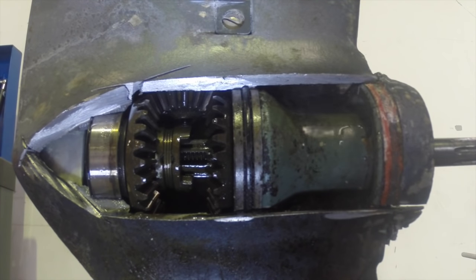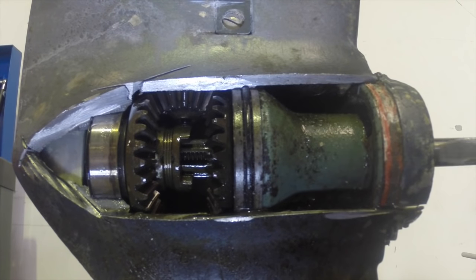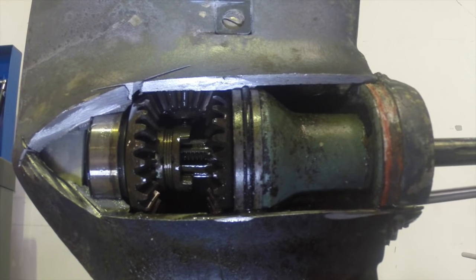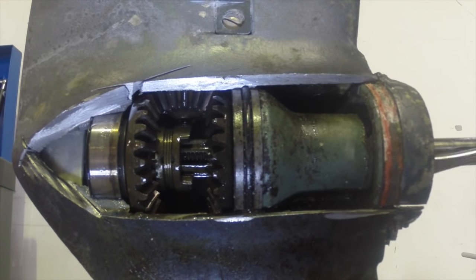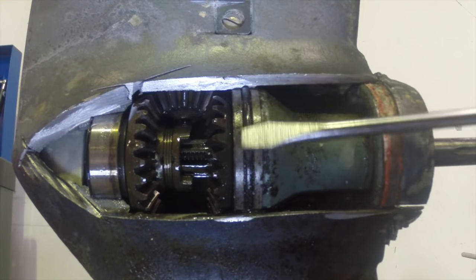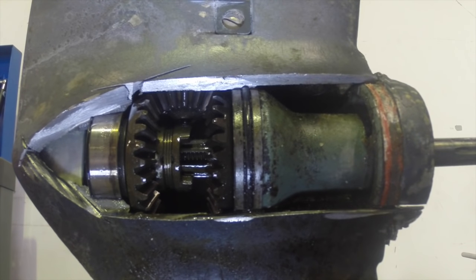You can see here, if I spray down the top, that's where the exhaust comes out. The exhaust comes down from the top, around this area, and then out between the prop. This section is open to seawater — it's where the exhaust and the bulk of your cooling water come out from behind the prop. Water can't get into the gearbox because of this O-ring here. And this whole section is what you remove if you want to take your bearing carrier out and replace the oil seals that are behind the prop shaft.